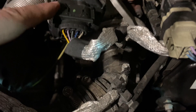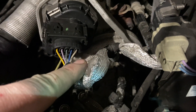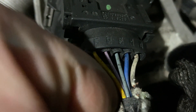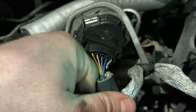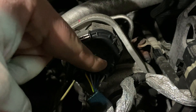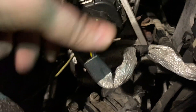Now actually this part here, this plug — it seems to be something to do with this bend or the material that's used on the actual turbo wiring. If you can have a look down here, you can see that wire there is actually broken. We actually done an ECU pinout on this vehicle before we knew about this, and we found there was no continuity from the plug between this wire and the terminal that corresponds to on the ECU, which is how we found out this was the issue.